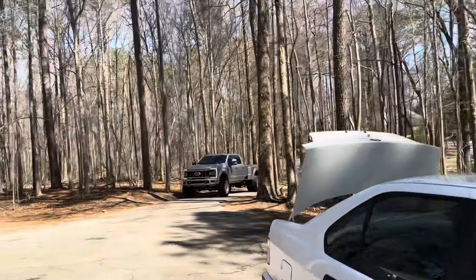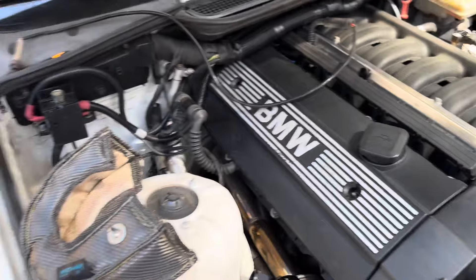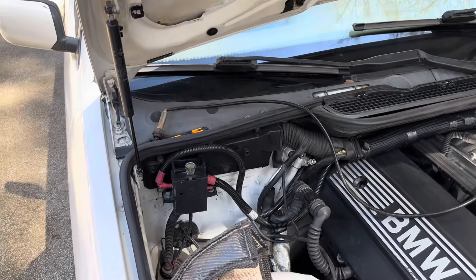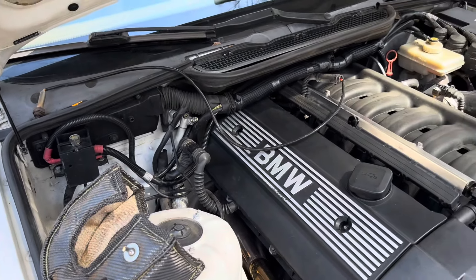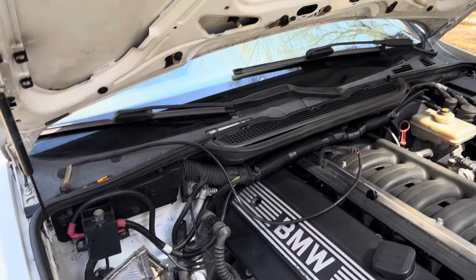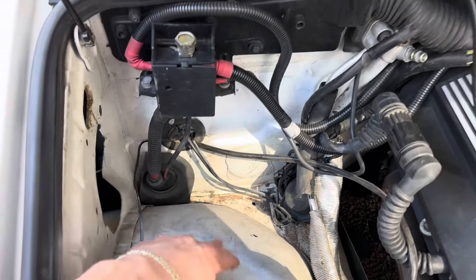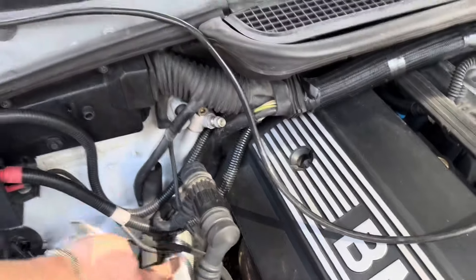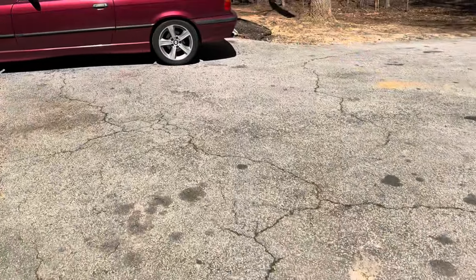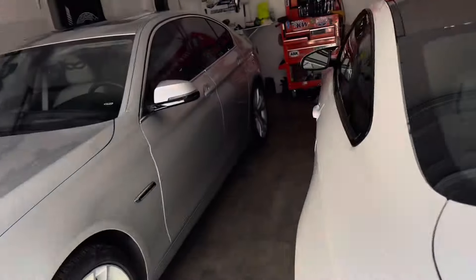Owner of Iconic Motorsports just pulled up for some E36 parts - bought some Vaders and an LSD. I'm finishing up here - finally got this cooling system in. I had to take apart the turbo and tap the housing for boost pressure. Going to do boost pressure to the wastegate, then wastegate to turbo boost pressure, and get the boost pressure source for the gauge from the intake. Bought this blanket, cleaned up in here, got a little bit of paint thrown down so it's not bare metal. Got a little bit of the wiring tucked. I just tapped this turbo and now I need to put a fitting in there with some Teflon tape, then we'll throw this turbo back together.